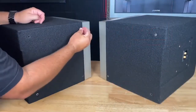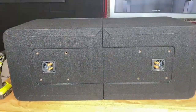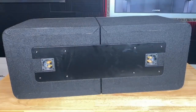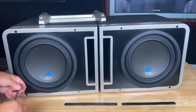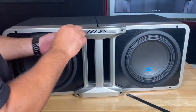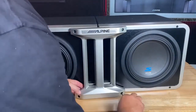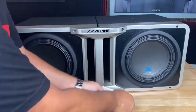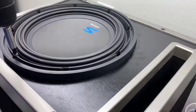These brackets come with all the hardware you need and have a beautiful front port coupler bracket and solid steel plate bracket for the rear. To install the ProLink system, you start with putting the supplied dowels in place on the sides of the enclosures. Using these dowels, you line the enclosures up and once in place, use the supplied screws to attach the rear plate bracket. After that's mounted, you can install the front port bracket by removing the two screws near the ports on both enclosures. Then using the longer screws supplied with the bracket, line up the metal plates and port coupler. I usually get the screws started with a few threads by hand and then tighten it all together. Once the enclosures are mounted together, you can rotate the inverted woofer so the logos line up properly.